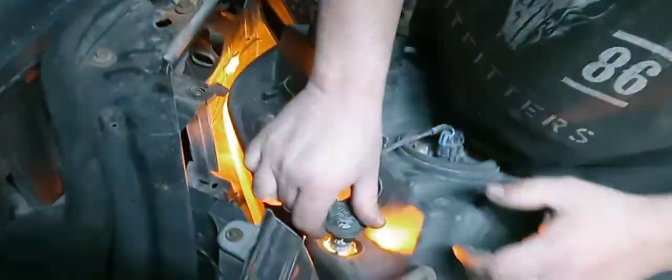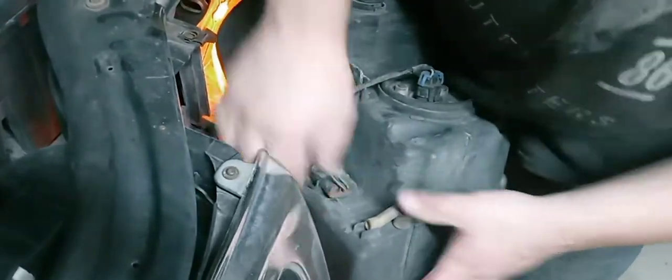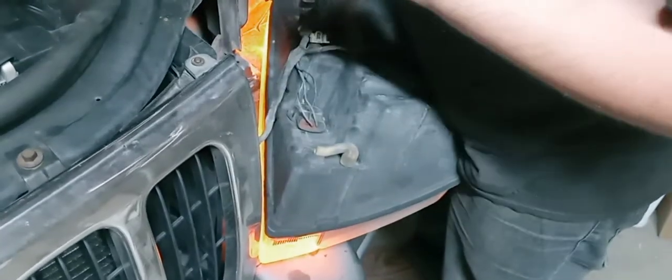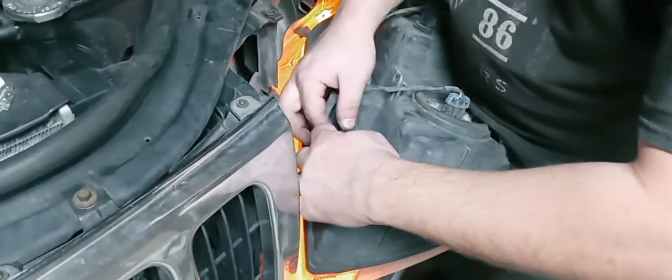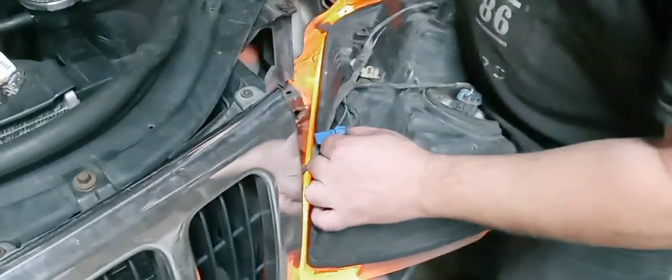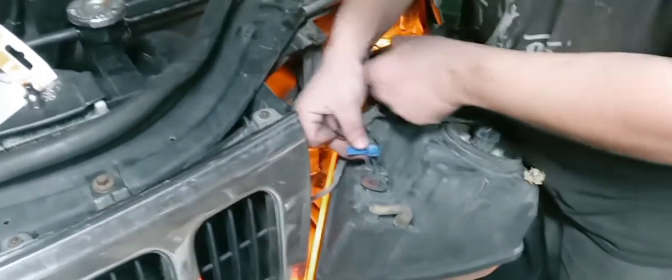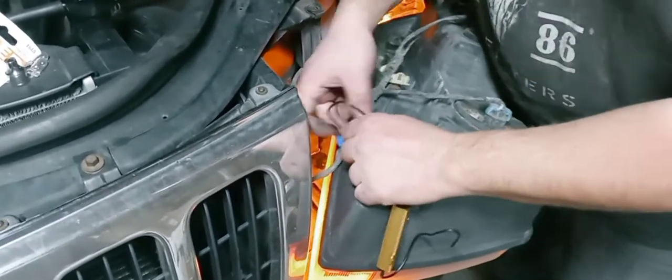Look at that. Ooh. So we can finish up this side. Okay, we got that done. Now we need to add a resistor here because you're going to have to. I might need to put you on pause because I got to get two more resistors, but I think I got some over there. Hold on. Keep it going, Mr. Green. Okay, we got that in there. Again, tap into, looks like your pink and black wire here, and then looks like to me you're going to tap into your green wire on your Jeep just to get your resistor in there.